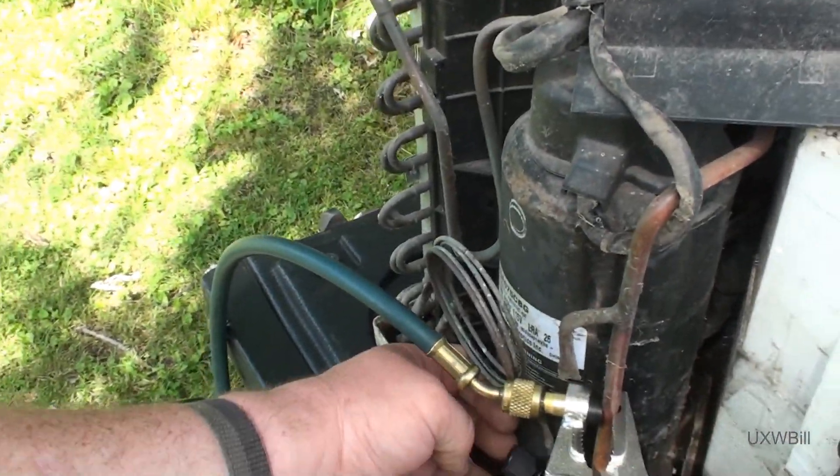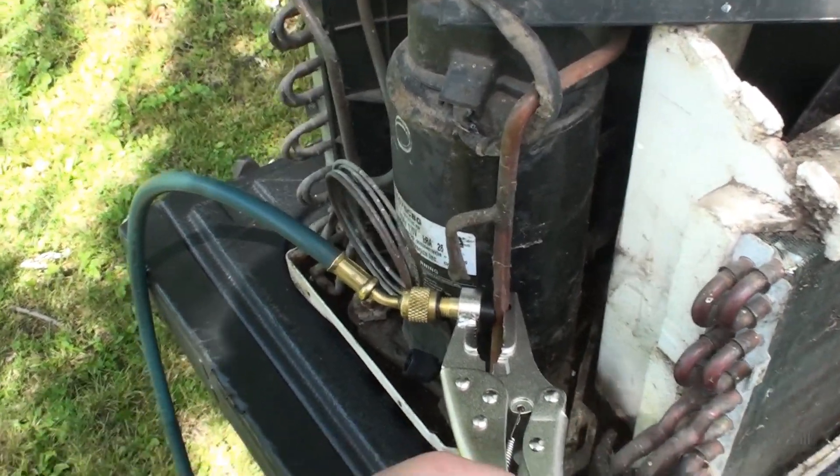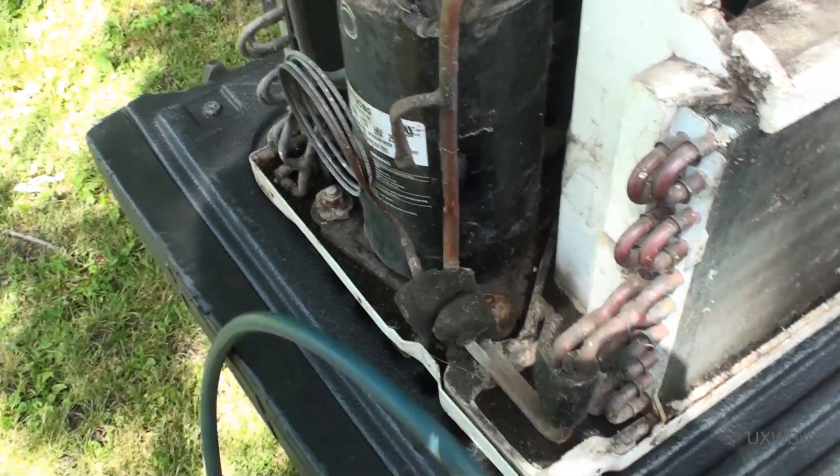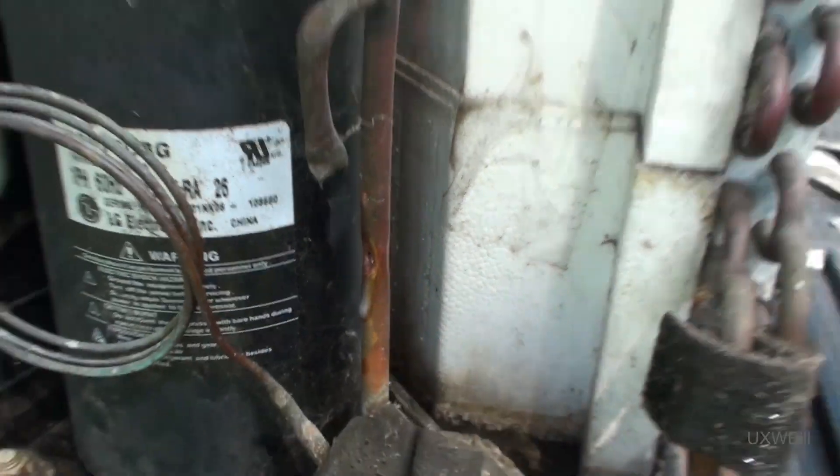Okay, here we are a couple of minutes later. Make sure this valve is closed so we don't get a nasty surprise there. We shouldn't get more than just the tiniest little spit of refrigerant out of that hose. Now that I've gone ahead and purged the machine, there might be a very little bit of vapor yet to come out when I pop this tool off. Yeah, there's not much there — just a little spit of gas. You can see the hole that it made. And now it's done.